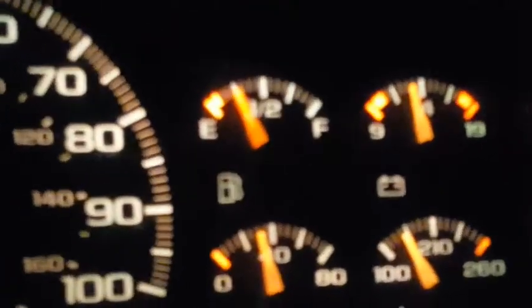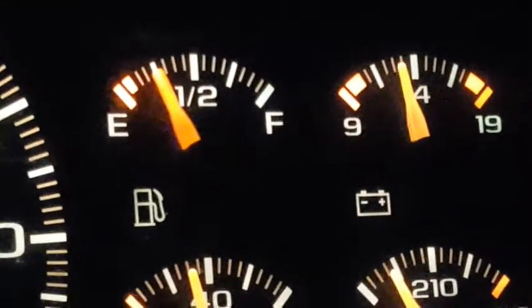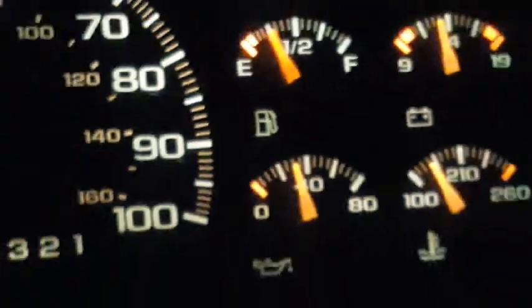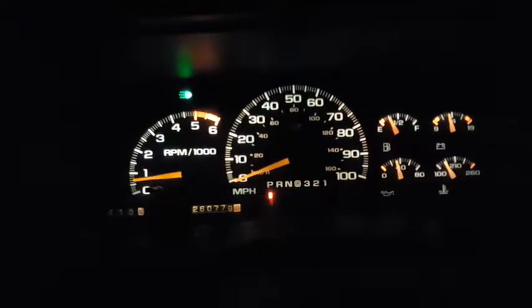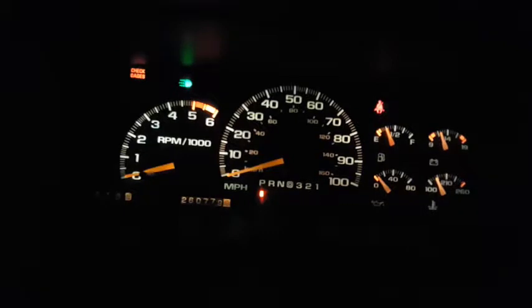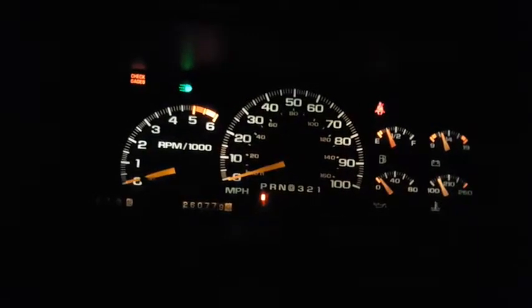The biggest voltage drop comes when I use my turn signal. With the left turn signal on again, it's flashing really fast. This afternoon it actually dropped down to about 11 volts — that's when the engine shut off, and it took 30 minutes before I could restart. When the motor shuts down like that, the entire instrument cluster goes offline — no fuel gauge, no odometer, nothing. By contrast, if I shut the engine off and just turn the key on, everything on the dash still works.